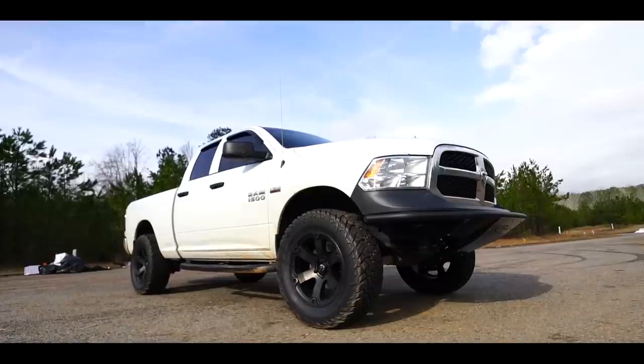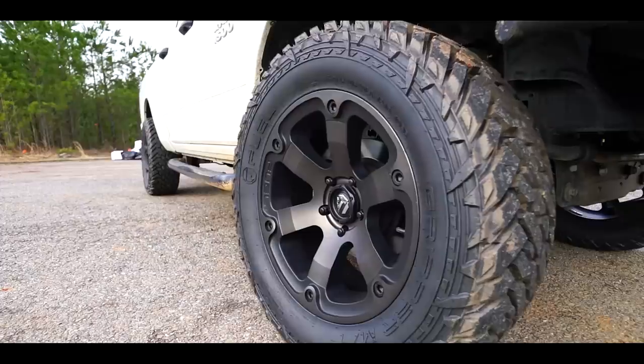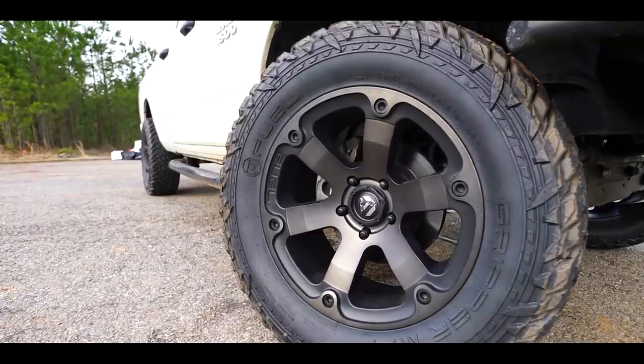Please forgive me because I don't know exactly what they put on. I went strictly by the shop's recommendation. I believe it's a two-inch leveling kit. It levels the rear out plus two inches in the rear, and then it levels the front out plus four inches. I believe. The wheels are fuel brand wheels. I think fuel beasts on fuel tires — 35-inch tires on a 20 by 9-inch wheel.